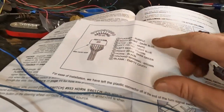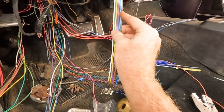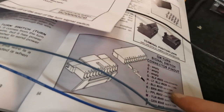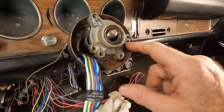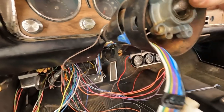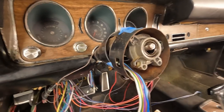Some good news: the turn signal switch has wiring and it matches up to the wiring in the book, so I don't have to do anything crazy. It's black, light blue, blue, brown, purple, yellow, green, white — and that's the order that it goes in. And in the book: black, light blue, blue, brown, purple, yellow, green, white. So I was confused with the springs — the springs don't actually go in here, they stick down through these holes. I took the little C-clip off the washer and turned it and this piece came out. So I need to put the springs on the other side. I basically took apart the entire thing — took this section off as well — because the springs have to go between these two points.